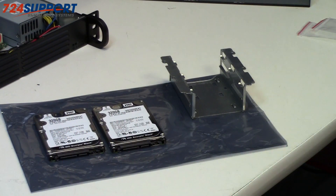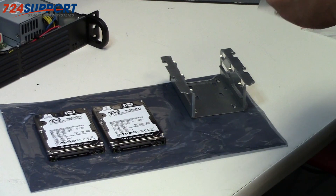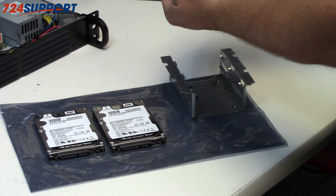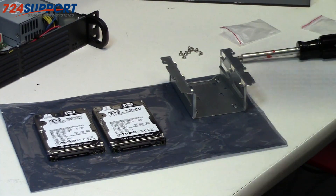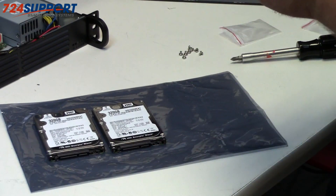Assembling the drives — this is annoyingly difficult, but fully functional. The 2-into-1 adapter works great. In this situation, we're going to be using it in a production reliability-critical monitoring server. You don't want the monitoring server to go down, so we're going to use RAID 1.